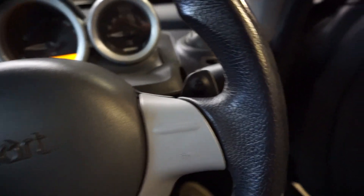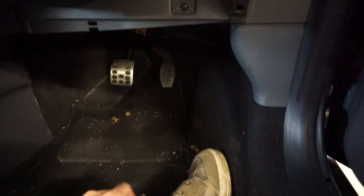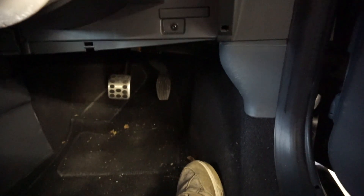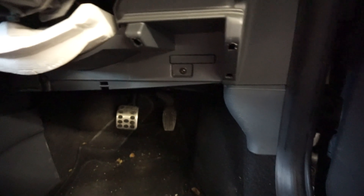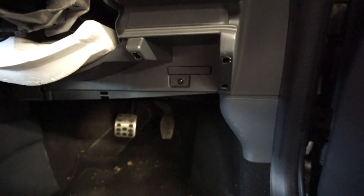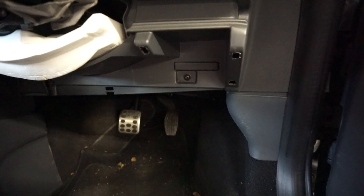Next, I'm going to have to get into the smart position and get my head right down into the footwell. Just above where the accelerator pedal is, there's a fuse box known as the SAM unit, and there's a little connector which sits right above it. It's an absolute pig to get to by the looks of it, but there's a connector there which sometimes fails and needs cleaning. I'll get the camera up there to show you which one I'm talking about.